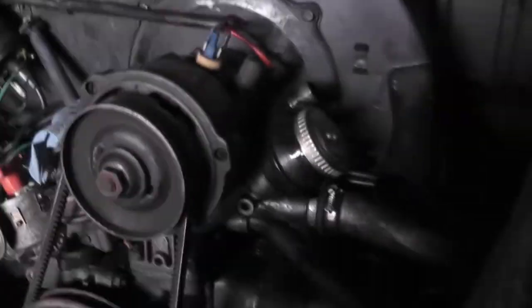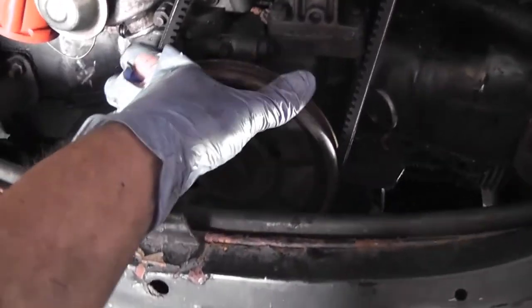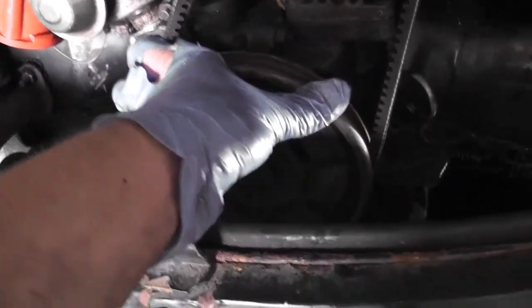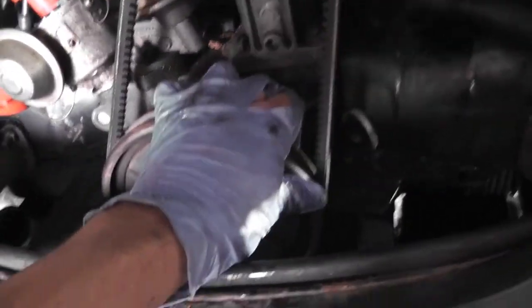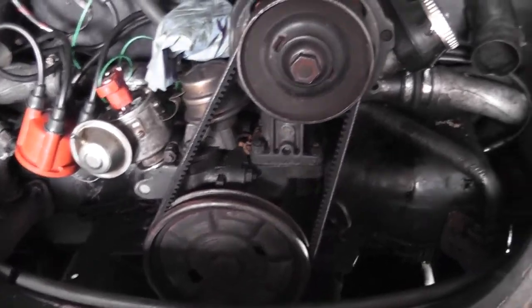One of the reasons why my channel is called Endfloat: endfloat is lateral movement of a crankshaft, and Beetle engines are particularly prone to it simply because they have a magnesium crankcase. What happens — especially if you're the type of driver who sits with your foot on the clutch the whole time — is you're putting pressure on the thrust bearing in the crankcase via the throwout bearing for the clutch, and you end up with endfloat. To check it, grab the pulley and see if you can move it back and forth slightly. That clunking is endfloat — you'll always see it in a Beetle in some way.